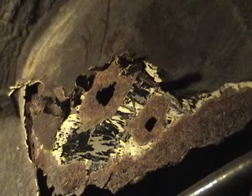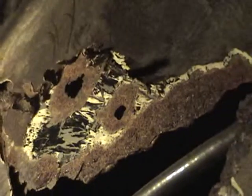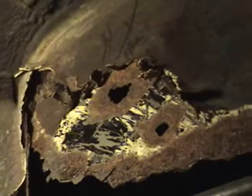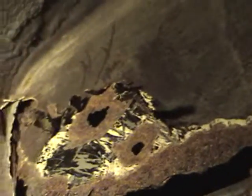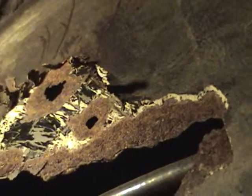But I noticed there was a little bubble there, so I started poking at it, and then I took the heat gun and the chisel and knocked off the bubbles in the undercoating there, which, if you were looking from a little further away, would look perfectly solid, but it wasn't, and that's what I came up with, those holes there. You can see the white stuff there is actually the undercoating, and you gotta hand it to Mercedes. They really did use a quality material here. The only problem is that it was not perfectly impervious, and over time you get these little cracks, and water gets in, and this is what happens. And usually you don't discover the problem until you have this much of a hole in your floor.